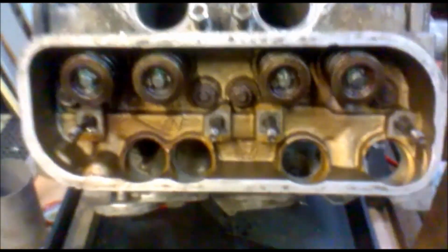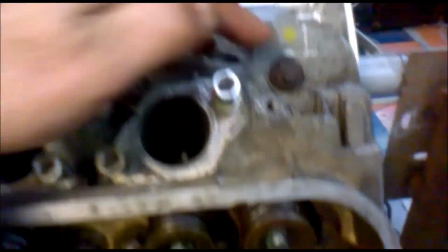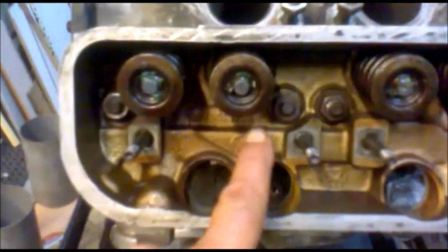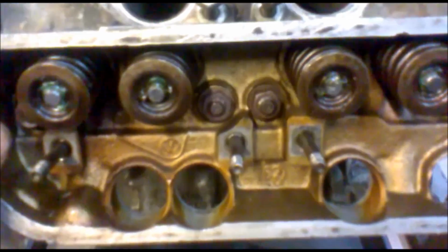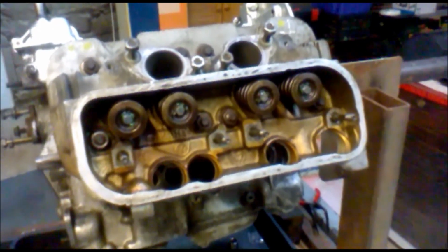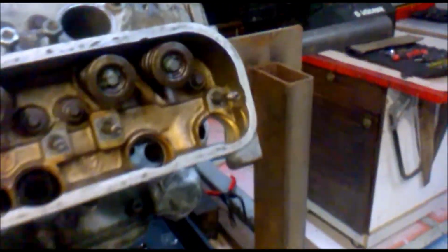And once you've got to 10, like I have here, check that all the washers really are nicely in place. It's not so much a problem on 2 litre heads, but on the other heads, they can wobble about a bit and so on. So anyway, just go through it, take your time, do the job progressively, and there we are. So that is the cylinder heads torqued down to 30 foot-pounds, 10, 20, then 30.